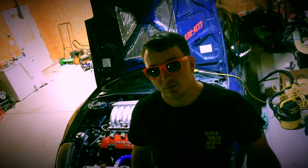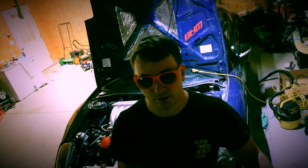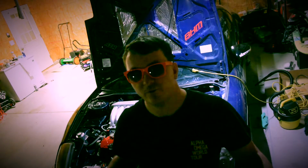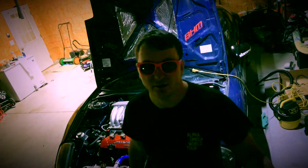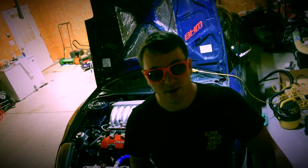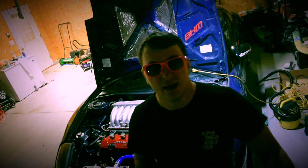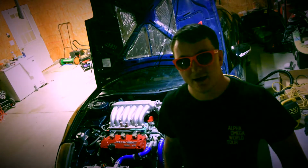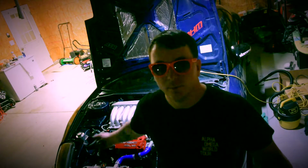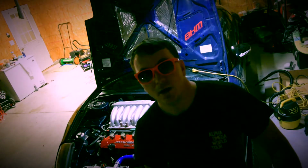But with that you can use the fuel rails without modifying them. Now for the 7.5 manifold, I'm using the 6G75 manifold that came on the motor, but I had to modify it a bit to make it fit. Now the lower intake manifold, I didn't really have to do anything to that. I gasket matched it, and had it ported and polished, what have you. You don't have to really do that unless you want to. It's out of the car anyway, because you have to get down to the knock sensor, and with the knock sensor you have to get to the crossover plate and whatnot.